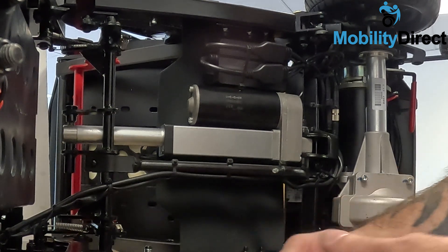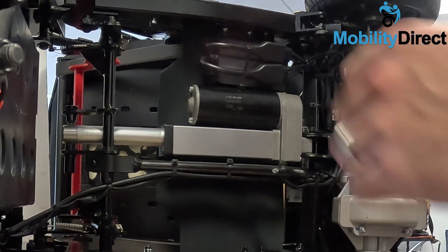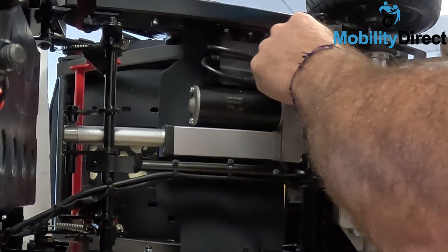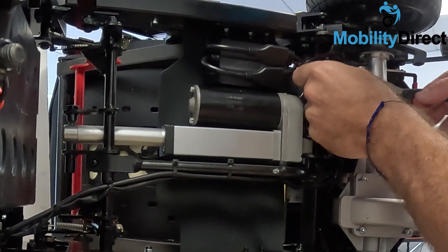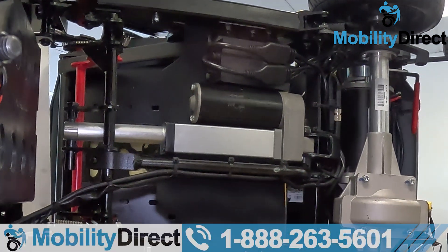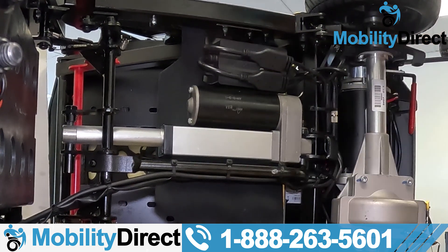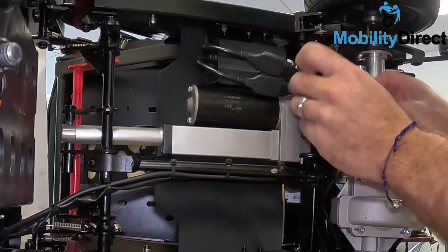The first thing we're going to do is remove the zip ties from the wire harnesses that are over the control module right now. Just grab a pair of snips and make sure not to cut any of the wires. Be very careful when removing the zip ties — you're going to have to remove several of them as the wires are bundled to the frame. When you're removing the zip ties it's necessary to keep in mind the orientation of the wires, how they're bent and where they are placed. This is a folding mobility scooter so you need to make sure that there are no pinch points on the wires, so be very careful when putting your wires back into place.